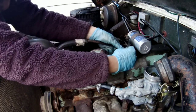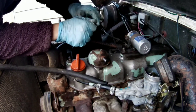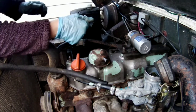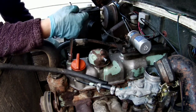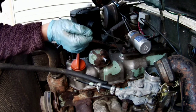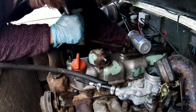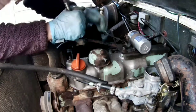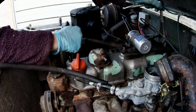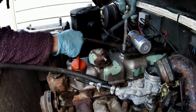You'll notice I don't give a damn about what it looks like under this bonnet. Before you go mad tightening these nuts up on top, just check your gasket's not getting pinched — make sure it's got a good seal all round before you do the final tightening up, otherwise you could be tightening it and the gasket might have slid in.